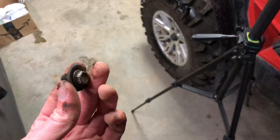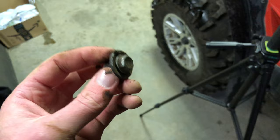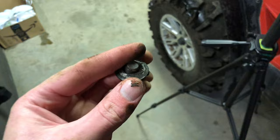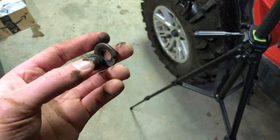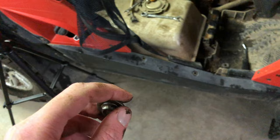So it was a 13mm bolt. As you can see, it's not a very long one at all. Mine was actually loose in there and I was able to back it off by hand, which is not good at all. When you take that out, make sure you get this washer too — the washer is not captive on the bolt, it can fall off. You want to make sure you get that because it is a critical part for actually holding the driveshaft to your transmission. Anyway, that came out super easy, should not have been loose, but it made it easy for taking out. Now we'll move back to the rear.